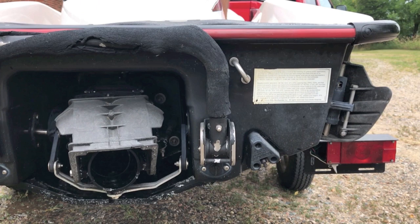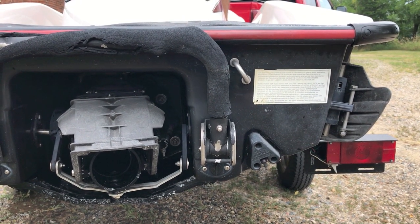You can see the circular exhaust portion of the impeller, and just above that is the actual reverser shield. That reverser shield, when shifted into reverse, shields, redirects, or reverses the exhaust water moving outward from the exhaust inward toward the impeller housing. It's that change of water thrust that propels the jet ski in the opposite direction. To stop the jet ski from going forward or reverse you have two options: number one, shift the lever to neutral, or number two, push the power button and turn the engine off altogether. That is how your thrust reverser works on your jet ski.